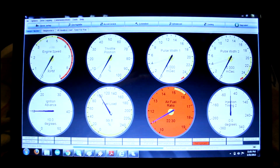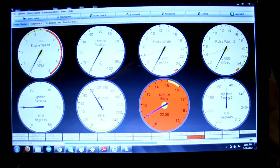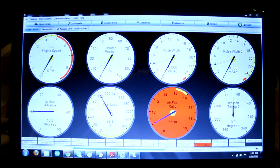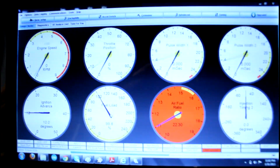I'm back from under the car. Somehow I managed to swap the 5 volt and ground signals for the crank position sensor. I found another pin-out online, hooked it all up, and heat-shrinked it better than I had it before. I guess that's karma for maybe not doing it right the first time.